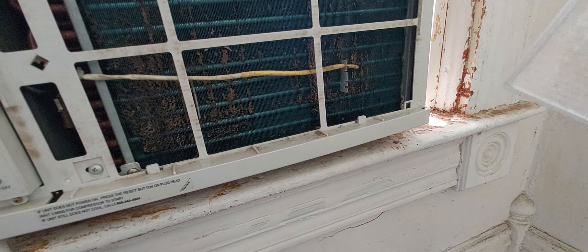Not a bad unit for Electrolux-built. I think this is one of the last R22 units before they moved to R410A, and it's a shame they got to this low of a standard. Date code LR, Electrolux Major Appliances. 6,500 BTU, 6.2 amps. R22, 10.5 ounces. 9.78 EER — that's not bad.